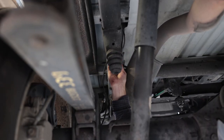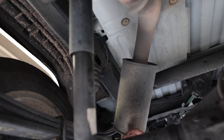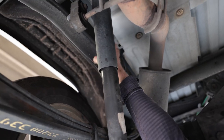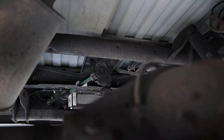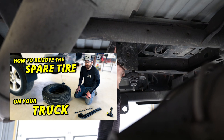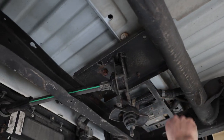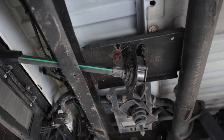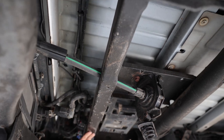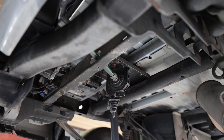There are a couple of spots — right here it's still soft and supple but it is flaking off a little, so I'm going to pick up any loose pieces because you don't want water getting behind them. But for the most part I don't really see anything loose; this has hardened up definitely over time. Back here near the spare tire there's starting to be a little bit of corrosion again, but it isn't that bad. This has been about three years since I did this coating — it's solid, no corrosion I can feel, everything seems pretty good.